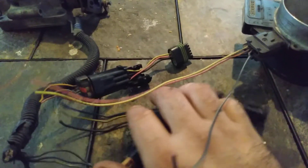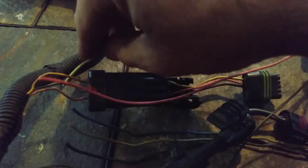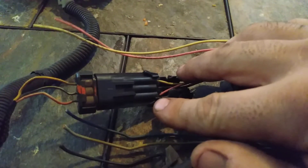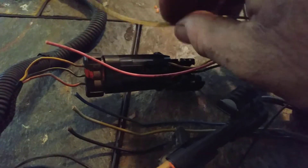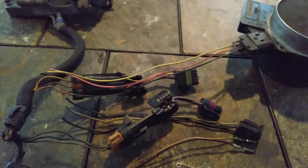When laid next to the yellow ZZP pigtail adapter on the stock wire, yellow wire goes to the yellow wire. Your pink wire comes across to the pink. I like to cut one wire at a time so you know what you're doing, but this is very color-coordinated. Yellow to yellow, pink to pink, and your black with a white stripe over to black with a white stripe. And that's all that's needed for your mass airflow pigtail.